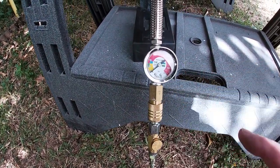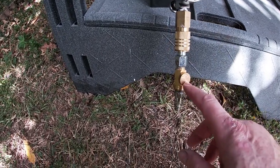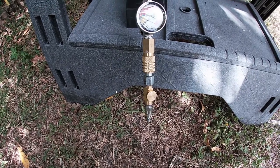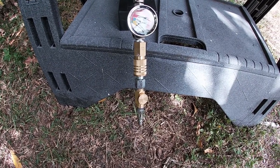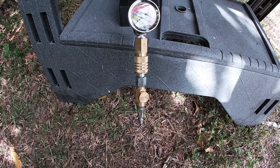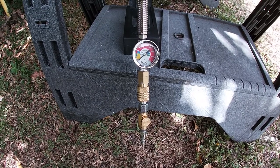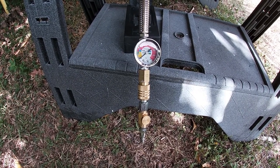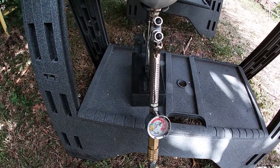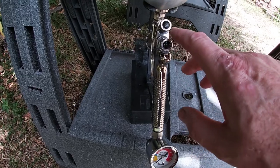And I generally try to keep it in that green zone there, between 20 and 30 pounds. And I do that with the help of this valve right here, because I'm really not using a pressure regulator on my compressor, just because it's not easy to use and it's not always accurate. So I'd rather do it right here at the gun, right where I need the pressure regulated. So that's working well. And the other major thing that I've done is really taking a look at the fan